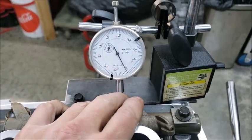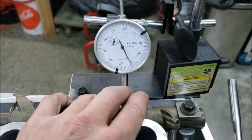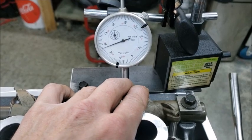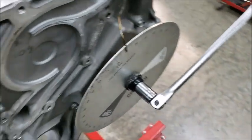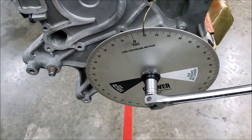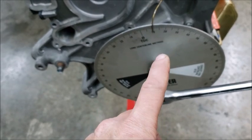What I do is I take my finger and put it on the rocker arm — that way you don't touch the actual retainer — and then you just push down on it. There's one: it's 200. So at 10 degrees, I have 200 thousandths before piston-to-valve clearance has any problems.